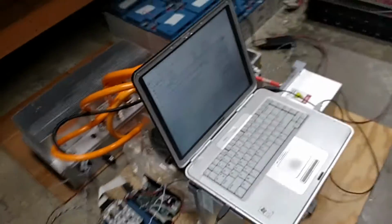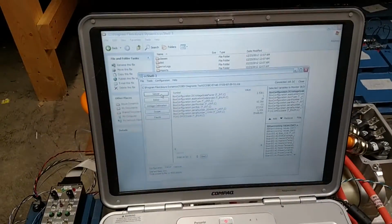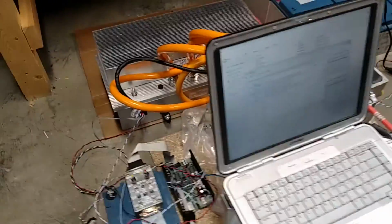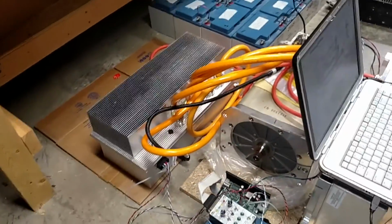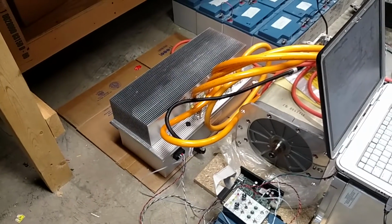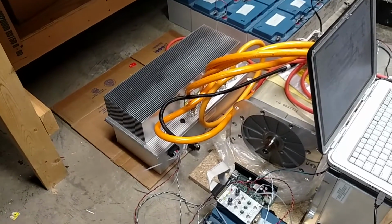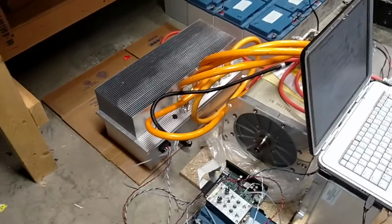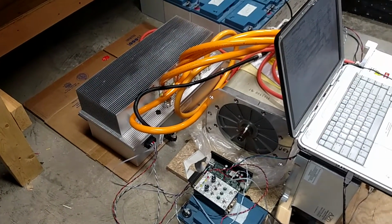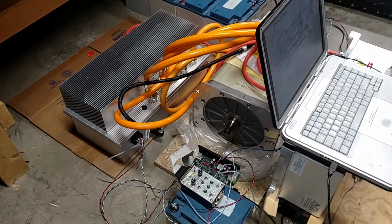Now, CC shell might have some engineering mode that we don't know about, or a different program that they used, because somehow that gets programmed into the EEPROM. And I'm pretty sure they don't do it before they solder it onto the board. They've got all these boards built up, and then they put it on a test fixture and write to it. Excuse me. So we'll have to look into that. But probably going to be another day.